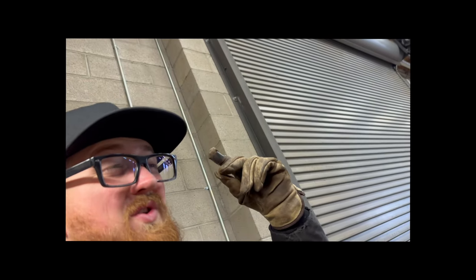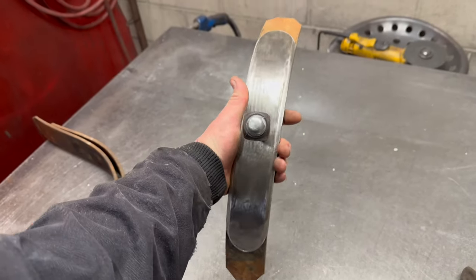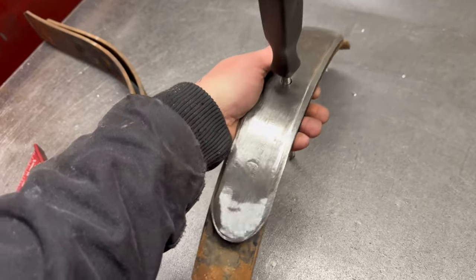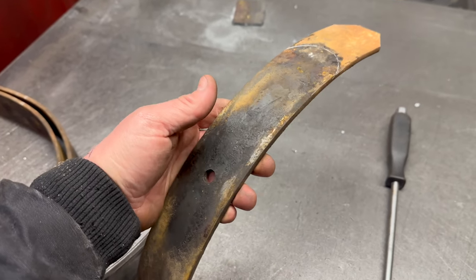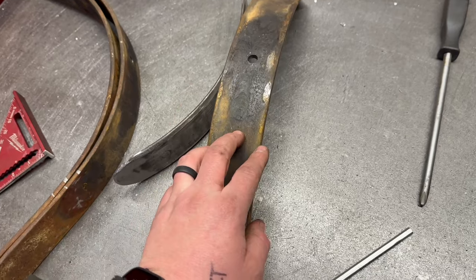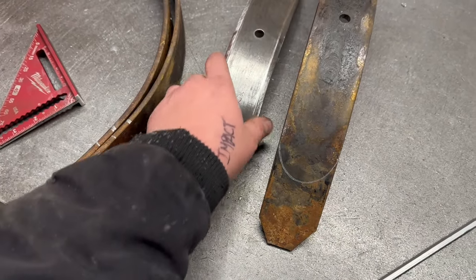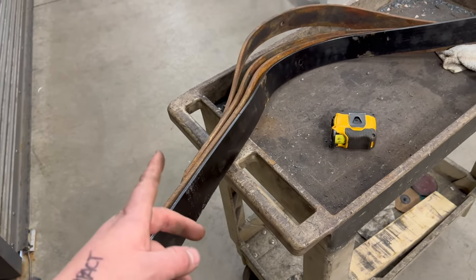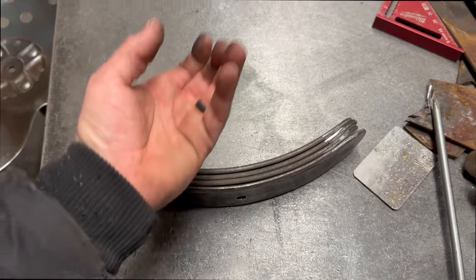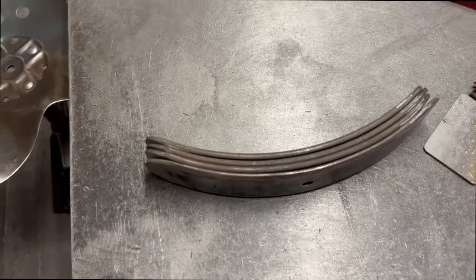Really wish I had a tripod so I could film myself working. I'm holding this thing together, keeping everything squared up, then taking my welder's pencil and tracing the profile so cuts are equal off center. I'll match the same radius with a light chamfer and scotch-brite finish on each leaf. A nice ring spacer sits underneath to compensate for the U-bolt and clip height to hold it in the frame rail nice and easy.